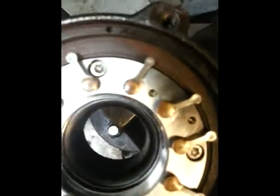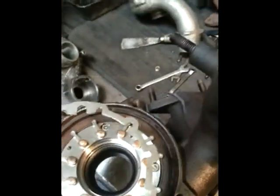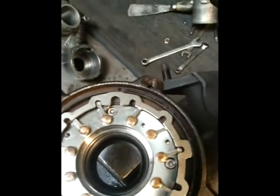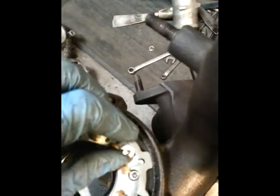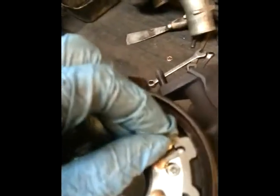Vanes are in and all three bolts are tightened up. The first thing we need to do now is put the operating ring on. If you notice, the bigger slot will always line up with the locating hole which locates the core. Just set it on roughly for now — don't try to slot it into place yet, because you need to insert the rollers and pins first. Take the little roller, slot the pin through the roller first, then try and slot it in at a bit of an angle and slot the pin down through the hole. You can see how it's nicely slotted into the groove and the pin is down through the hole.